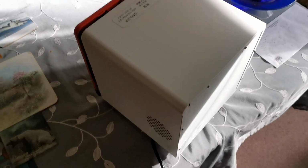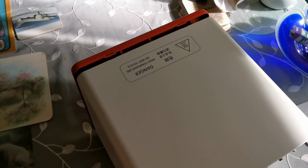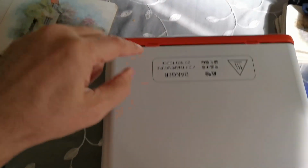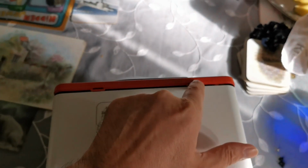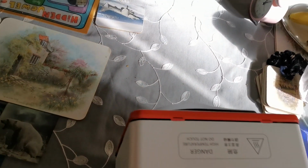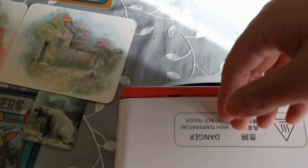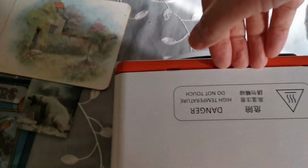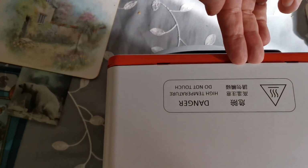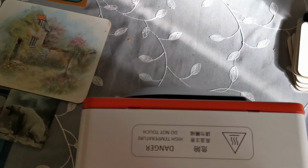Right, so I put the back cover on, and it just slides on from the back, with a little tweaking. I put the back plate on, and now I get the cover to the front of the roaster, and there's a couple of nibs there that need to go over these front bits, so I need to get those over and ensure that the sides are correctly engaged. So I'm going to pause the video where I do that, and the way to do it is to get your nails just under here and lift gently, and then push on the front of the roaster and use your stomach to push the back towards the front. Now I need two hands because I need to hold the roaster there, so I have to put the camera down again.